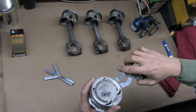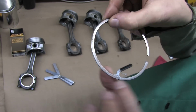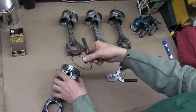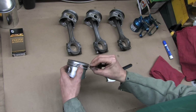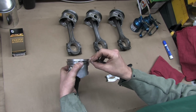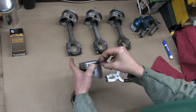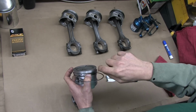When you're disassembling your pistons, always use piston ring pliers on the compression rings. Pay close attention to the shape and the color of the rings and any markings that help you determine their orientation. Some may have stamped markings on them to indicate which way is up. Others will be burnt on one side and shiny on the other. Different types of rings have different shapes, and there's a diagram in the service manual about all that. Sometimes they're beveled or grooved. Give them all a thorough inspection to ensure they're not cracked or bent and that no binding has occurred.